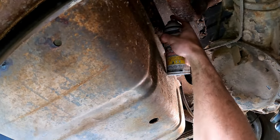I'll post this up on Marketplace today and see if we can make a couple dollars. They can't all be winners — you can't fix everything. This would not have been a fire-it-up-and-drive-it-home type of situation. She's gonna need a little more than that. Always relieve the pressure from the fuel system before taking lines off. Whenever you use a fuel pressure gauge, make sure to blow the fuel out of the line so it doesn't get all gummy. And if you're using a fire extinguisher with gasoline in it, empty it out and lubricate the valve — or actually, just don't ever do this at home.